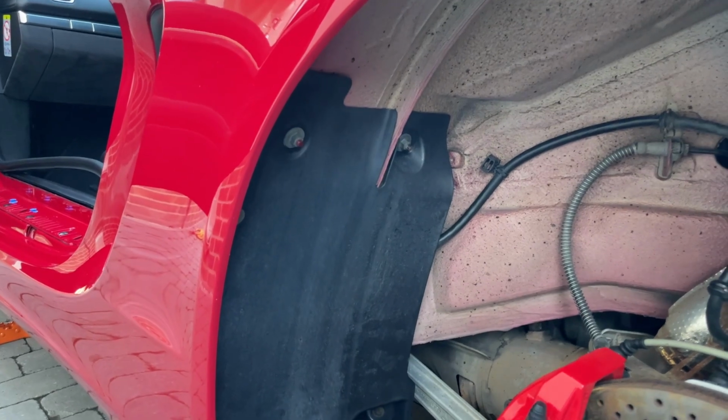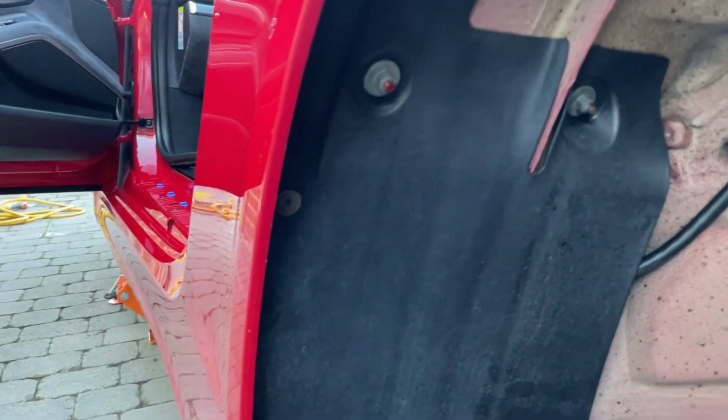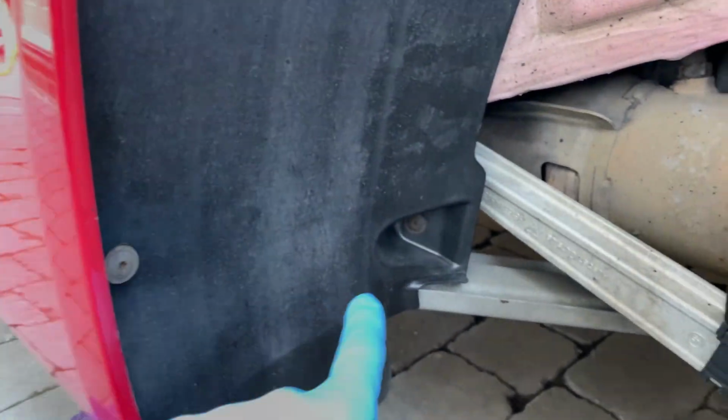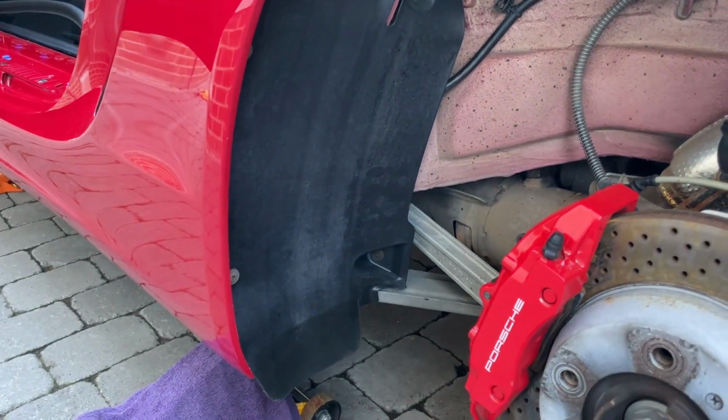Right, rear wheel arch liner on. Quick reminder, there's 2 studs at the top, there's 2 T20s there, one there, one there. There's another T20 there, and there's a T25 under there. You can see that there. And there is also a T20 just, hang on, there, which is securing the sill to the wing. So that's your fastener count in the rear wheel arch.